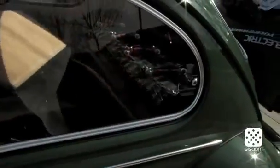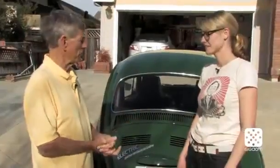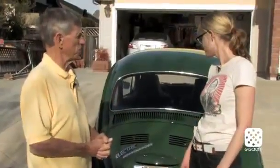Half of the pack is in the front for weight distribution. The other pack is in the back behind the rear seat to maintain a 4-passenger car. Right, so that's very rare. An EV still maintains its seat capacity. Most people take out the back seat and fill it with lead acid batteries, and they add about 2,000 pounds. I've added less than 600 pounds.